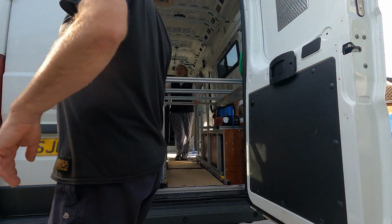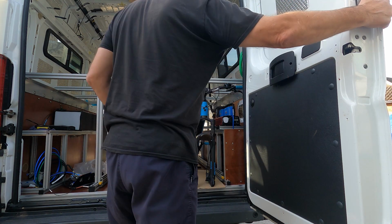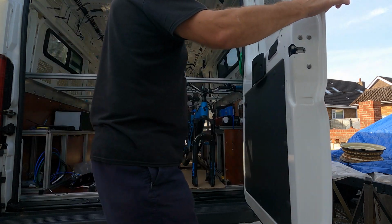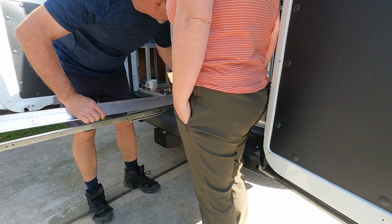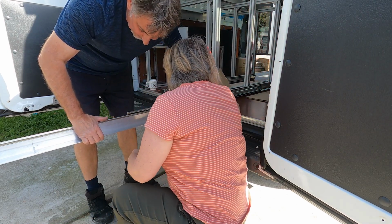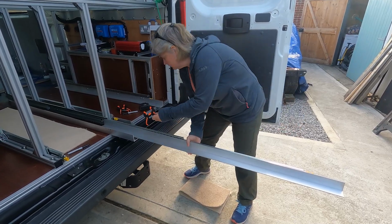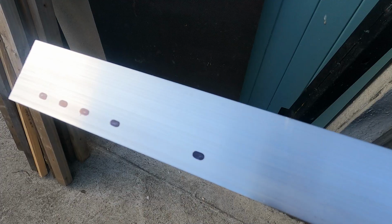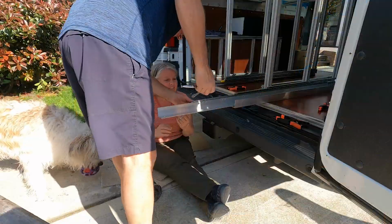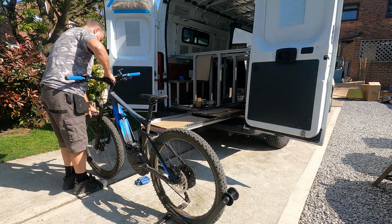With the slides installed, we check the length of the angle we need in order to support the base of our slides, the distance lengthwise for the tray. The base I'm using is polymer-coated marine ply, the type usually found on Ifor Williams-style trailers.